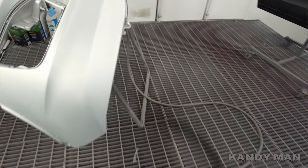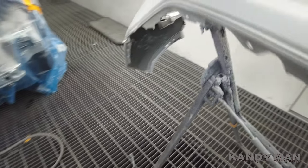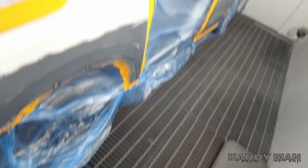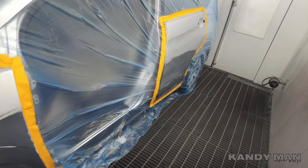I'm going to use the 3M Performance gun on this one for base coat and try it out again on the silver. I like that gun for the base coat so I'm going to start using it more on base. It works good for other stuff too but I like it better for base coat. It's easy to clean - you can change out the cap and the head real easy, clean the needle off and you're ready to roll. It doesn't have any problems with the gun spitting out different stuff with the colors.